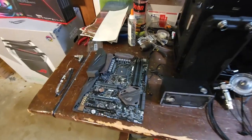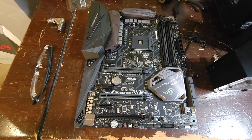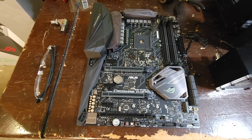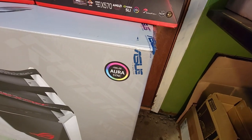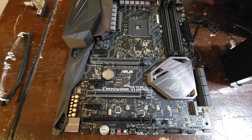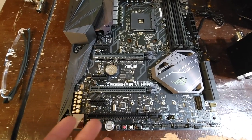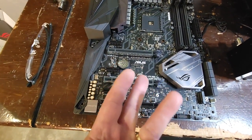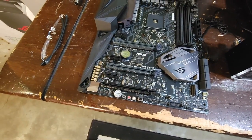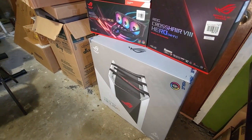I said, okay, I can control my Aura Sync with my Crosshair VI motherboard — but when I went to plug it in, there was no place to plug it in. Aura Sync uses addressable LEDs, and my old motherboard doesn't have addressable LED headers yet. Addressable uses three pins, and regular Aura uses the four-pin LED strips. I could plug those in, but I couldn't use anything I just bought to light up — not the fans, nothing. It was all going to be dark.